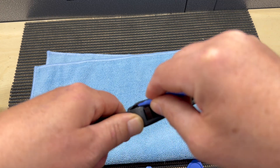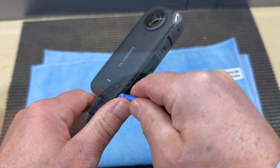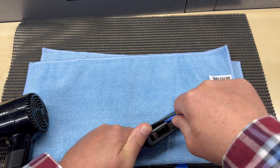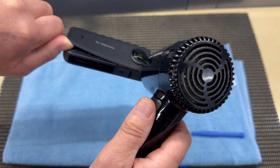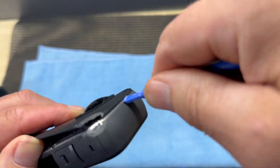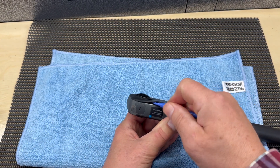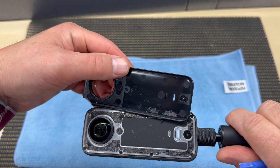You could use your fingernail to get it going, then insert a plastic credit card if you haven't got the blue plastic pry tools. Just take your time and apply some heat as needed to keep the double-sided tape a little soft. When you get up to the lens area, be very careful. Apply more heat if needed and it should all come off easily. This is what's left once you remove that plastic cover from the back of the camera.